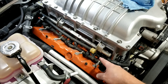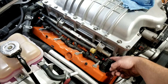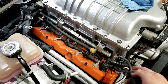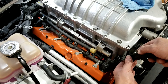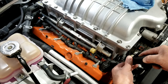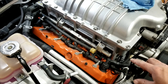On this side I'm just going to show you how to release the locks. You can either get your fingernail in here and pull up — sometimes that's a little hard — so you can use a little screwdriver or a hook or a pick to get behind this red piece and push up. They'll pop out just like that and that's released. Obviously they're brittle plastic so don't break them off. You have to do that to all of them before you can actually remove the plug.